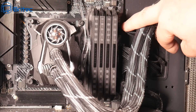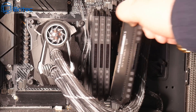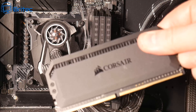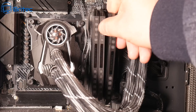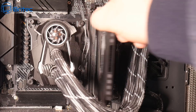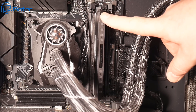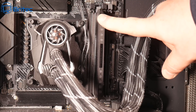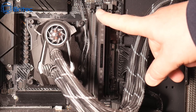Work your way through each RAM stick to see which one is bad. Also check that the RAM slots on the board are okay, because sometimes these can go bad or come bad from the factory. Pull the sticks out and try booting with just one stick, then swap for another and keep trying until it replicates the same problem. If you've been messing around in the BIOS, reset it back to default settings or clear the CMOS by removing the battery. You're going through each individual part to check where the problem lies.